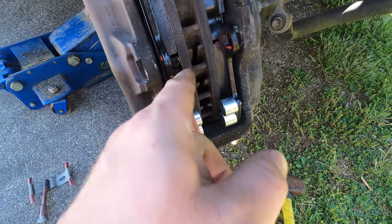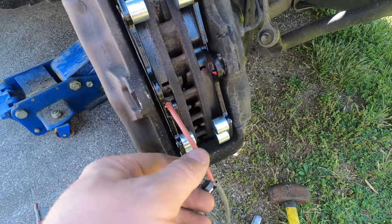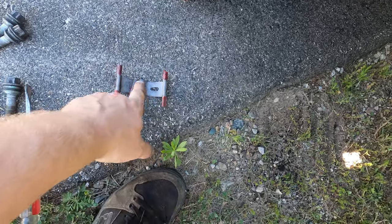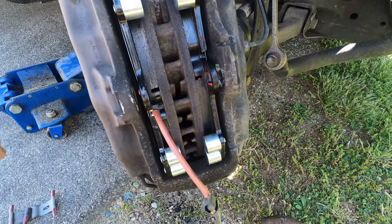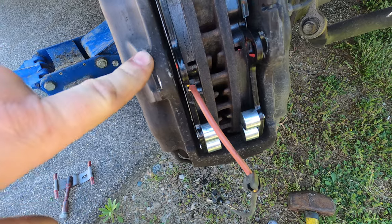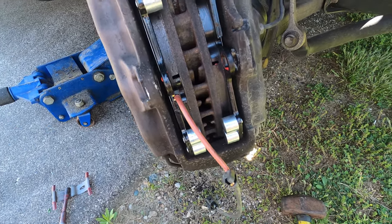I clipped one sensor in — it goes in really easy, just push it down until it doesn't go down and it won't come out. That spring is going to go in there and this clips into it. We'll put the sensor in place and route the wire afterwards. So a thin layer of grease on the bolt, a little bit on each part that's going to hit — our touch point so that when it rides along here it won't squeak. A little extra in that groove in the middle where the bolt sits. With them cleaned up in the sandblaster it was super easy — just push on here and wiggle the bolt in from this side and it'll pop right in.